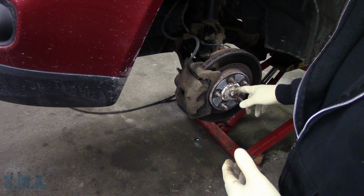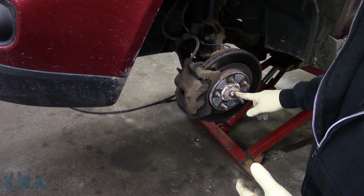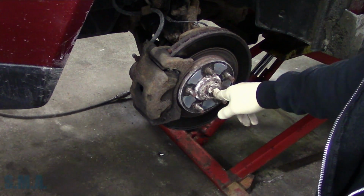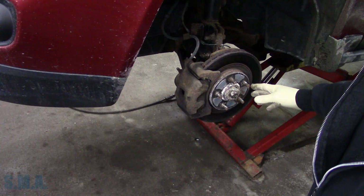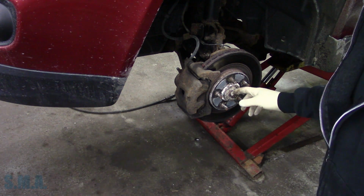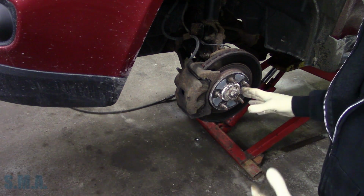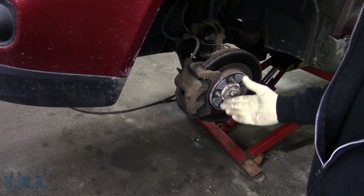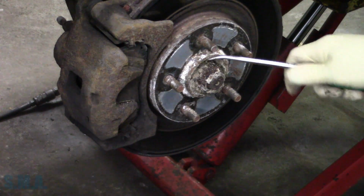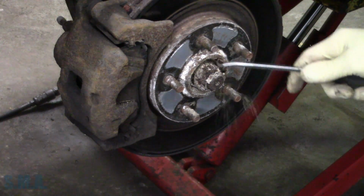What I want to do is see, more than likely, it's a bad magnetic tone ring. I know these vehicles are prone to this right here, turning into a white glob, can't get the axle out, whole thing turns into a regular show. But I thought if we could get the axle on and off, just push the axle in so we can give a visual inspection. But we're gonna maybe find out that that's not possible, so let's pick away at this a little, see what this looks like, see if it's even possible to put a bearing in it if that's what it's gonna need. We've surpassed the WD-40 at this point. But you never know, sometimes this stuff surprises you. You get it out and you're like, hey, it looks like crap, and then 5 seconds later, things falling apart.